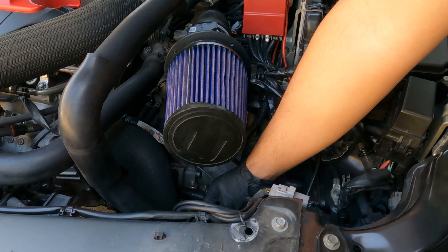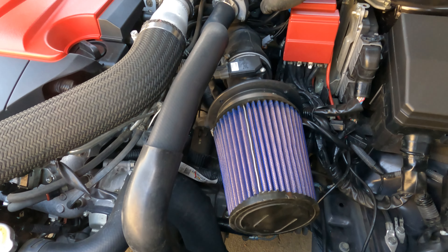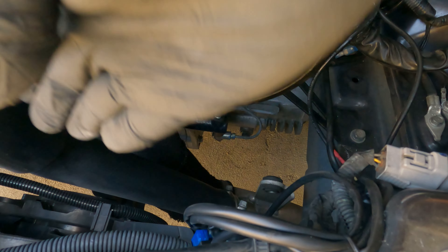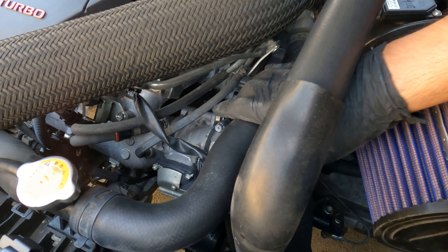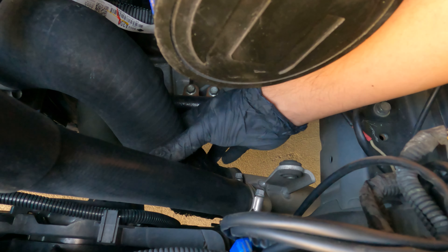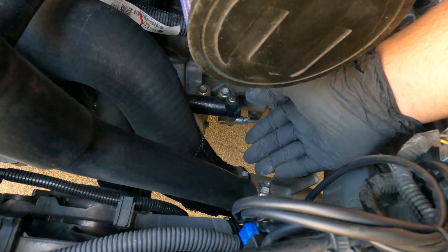So there's two pipes on this portion, two outlets. One goes straight out to the blow-off valve right here, then one on the bottom right here leads straight to the throttle body, which is right there. The main reason to do this modification is to cool down the engine faster. And what I've read on the forums is that you don't really need a tune to do this. That's why I'm doing this, because I don't want to tune my car until I get maybe a bigger turbo.